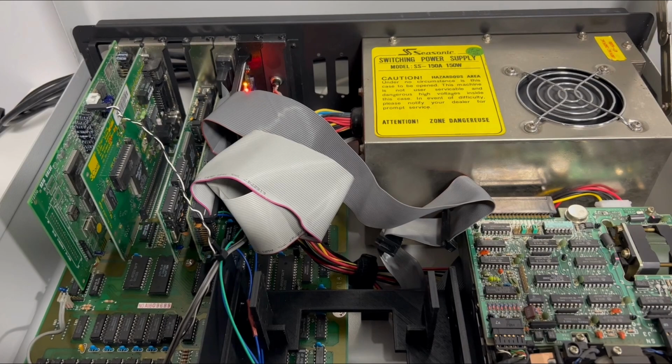Lastly, we've got a sound card. I would say that any sound card in an XT is overkill, even an AdLib, but I did want to play some games that use sound effects, and for this, the Sound Blaster 16 Value is a suitable choice. This model of Sound Blaster has an input header for the PC speaker, and it can route the sound through to the sound card. It also has a real OPL3 to emulate the AdLib for those early games.